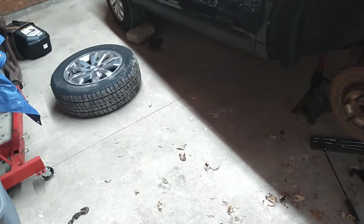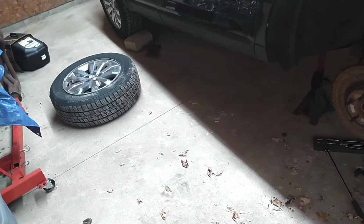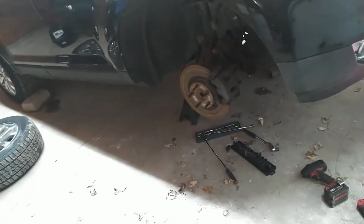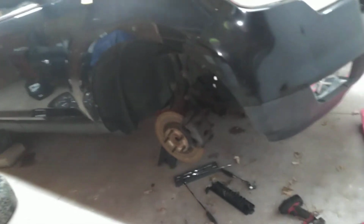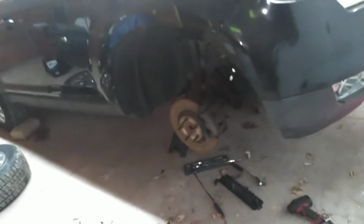In hindsight, when you pull a PTU out, you have to take the whole exhaust off, so you have to buy all the exhaust gaskets. At least I did. Mine's all rusted out. When you pull a PTU out, the transmission drains itself, so you have to buy transmission fluid. So it's a reasonable amount of money to spend.